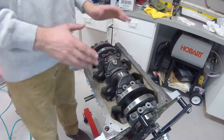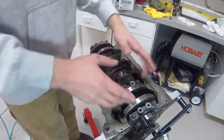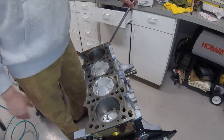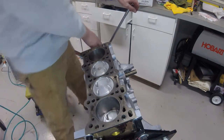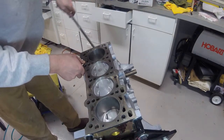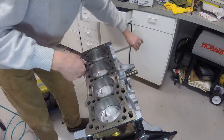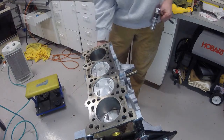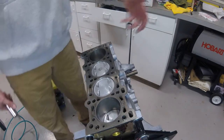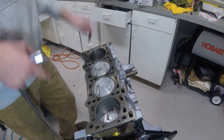I already had one piston in before just to make sure I was doing it correctly on this motor, so I've got two done now — time to do the final two. Once all the pistons and rods are installed and connected to the crank, I put the crank pulley bolts back on and use a breaker bar to check the rotation of the engine a few times to make sure everything is spinning freely and nicely. Everything feels real good — nice smooth motion, no hiccups or drag. Rotating assembly is now complete. Next time I'll be doing a video on installing the oil pump, oil pan, and windage tray. Thanks for watching — hopefully this helps you guys out.